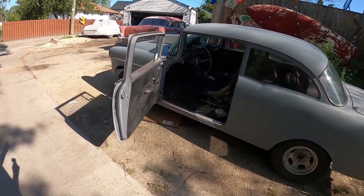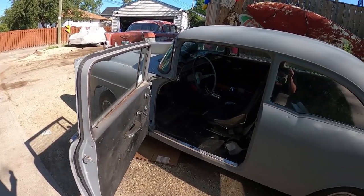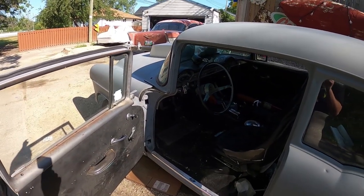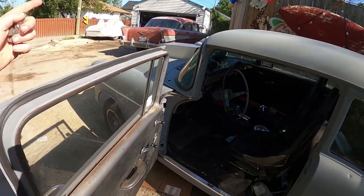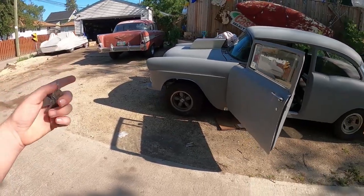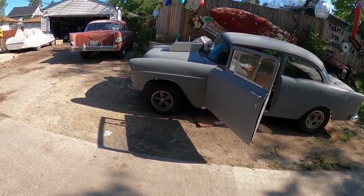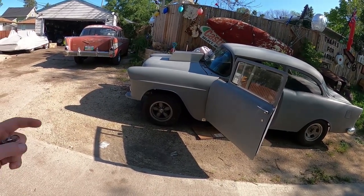And over the winter, I had a motor built for it and a transmission. If you go back, you can see all the dilemmas I've had. I put the transmission in, it was screwing around, I changed it a few times, and then I got the motor in, that was fine. And now what it does is under acceleration and braking, it drops oil pressure for some reason. And at like 6,500 RPM, it drops oil pressure too.